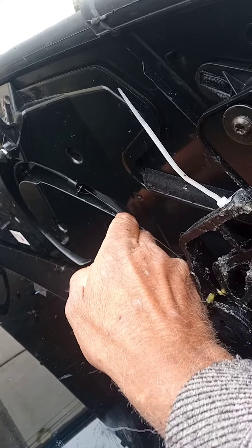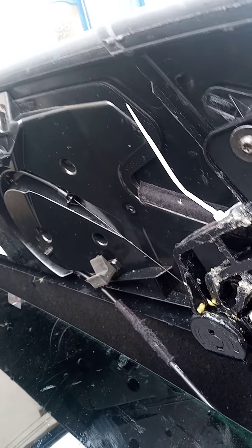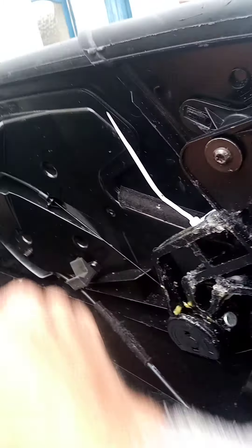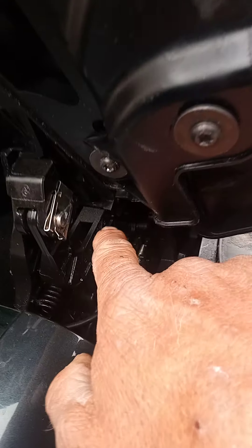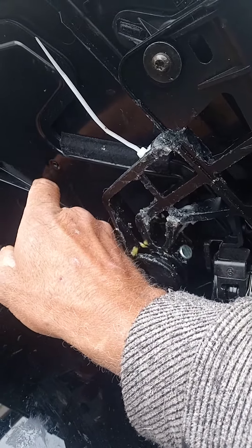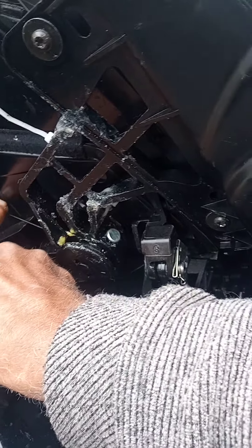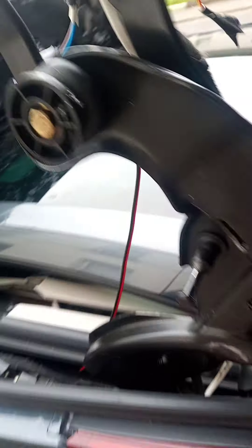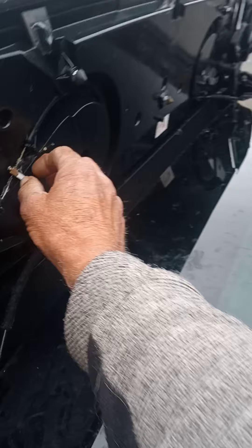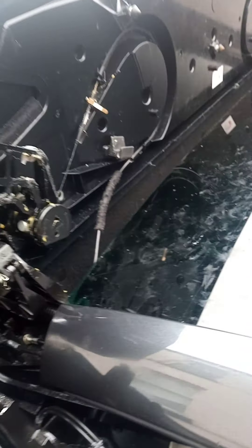The other side I had to replace with a two-pound Halfords gear cable which fits in the nipple at the other side - the lever down here - it locks in quite nicely. These are no longer supplied by Renault. I went to my local Renault dealer and they no longer stock them, so if you break the inner cable you either repair it or the job's stuffed really. I've done a repair here using parts of a plug to lock it nicely and they work very well.